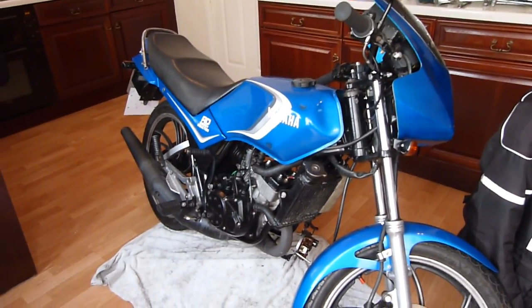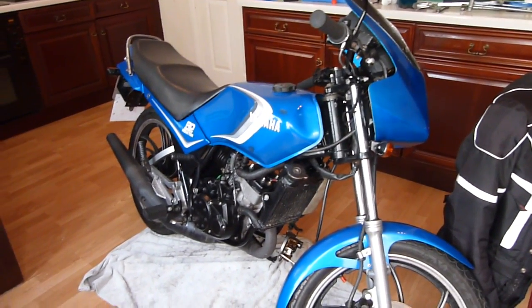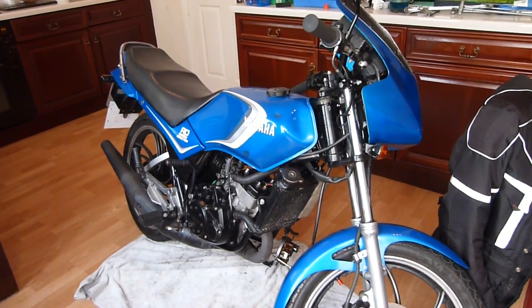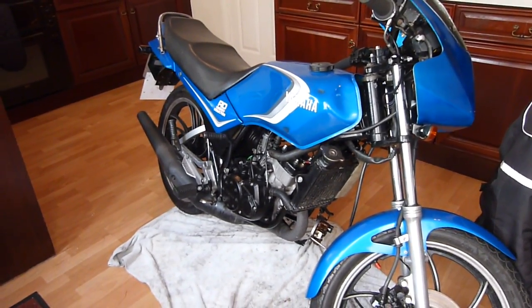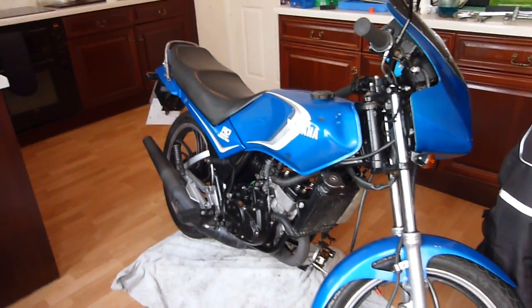The second issue was I was losing coolant. On long rides you'd find your radiator would empty around about a quarter and your expansion bottle would be empty too. I thought okay, that could be a head gasket or water pump seal, so I might as well do them.